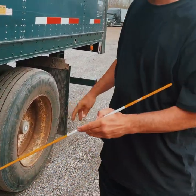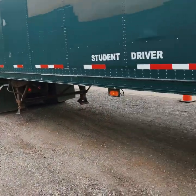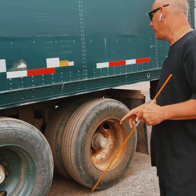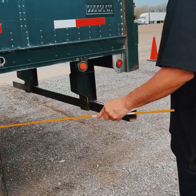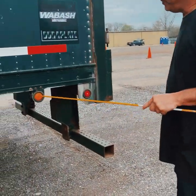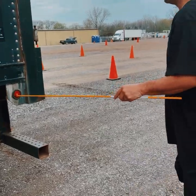Note the seal naming convention: starting from the front steer tire, that's a hub seal; go to the drive tire, that's an axle seal; finish at the tandem, that's a hub seal again — hub, axle, hub, easy to remember. Mud flap: securely mounted, not cracked or broken, not worn, torn, or frayed, enough distance between mud flap and tire. ABS light back here: securely mounted, not cracked or broken, proper color. Side marker light: securely mounted, not cracked or broken, proper color.